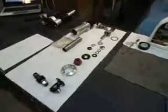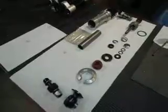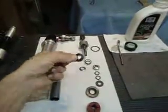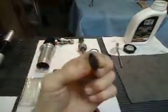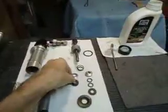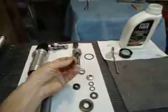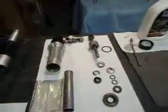I found some very dirty oil inside — very, very dirty oil. The actual leak is caused by this part here: a very specialized little rubber o-ring. And this steel piece rides right next to it, and it's rusting. I don't like that because rust will float around inside your oil, and it's just not good for parts.